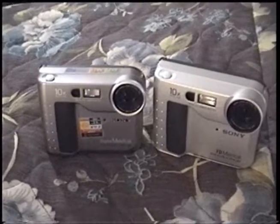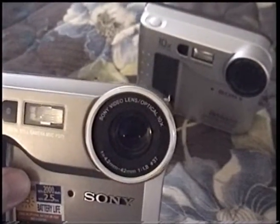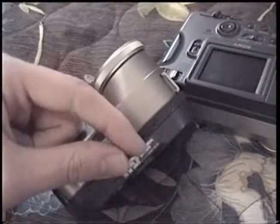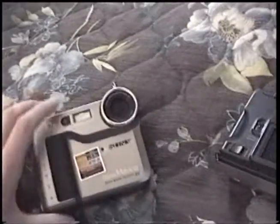Another thing I learned, a couple of you tipped me off to this, so thank you. The lenses are basically copied over from a Handycam. And a neat thing is, apparently, the CCD actually isn't parallel with the lens. It's actually perpendicular. The CCD, I guess, sits down here. So it sits the way my finger's oriented, and then there's a mirror like that that bounces the image from the lens down to the CCD, so that's kind of interesting. I wonder if the newer Mavicas are like that, or if they switch to a parallel CCD eventually.